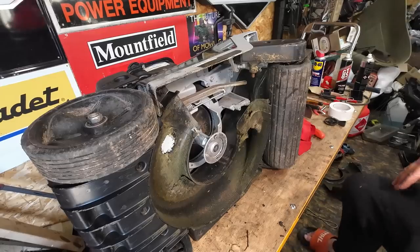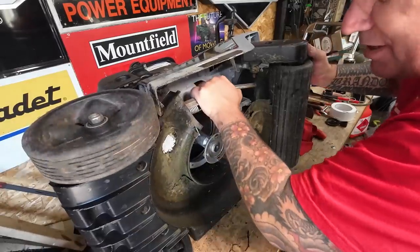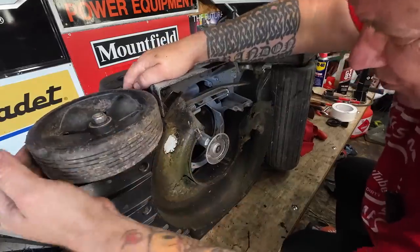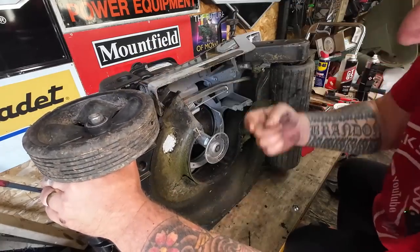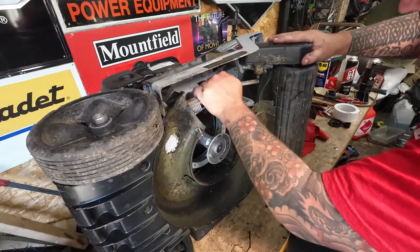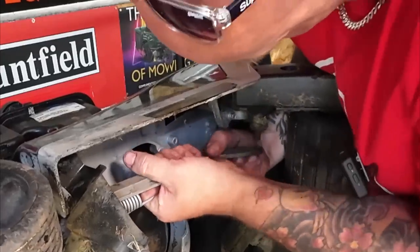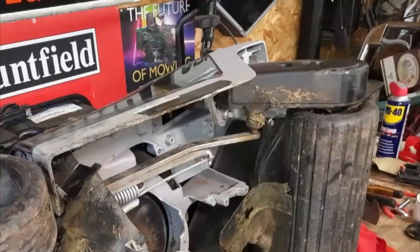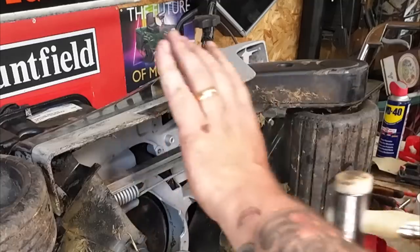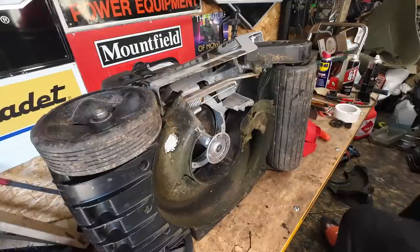Let's try and get that put on there. I might be able to do it just with the height control. I've got to move these wheels - these are all under tension, that's the biggest problem. You have to try and manipulate these wheels outwards so that you can then get hold of that tension pulley. It's not a lot - literally about four or five mil. Once it's in place, it's in place. I know my mate Conker - he had one of these and said they're an absolute pig to do. But they are one of the easiest fixes I know on these little tiny machines.